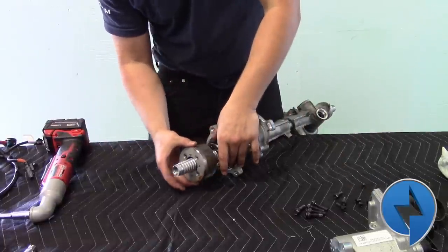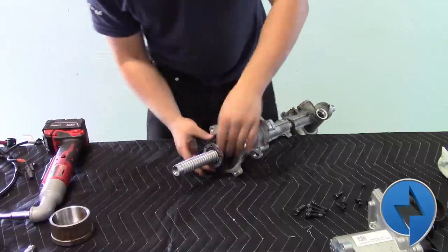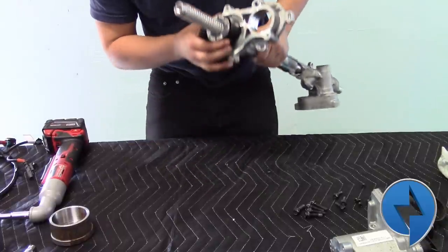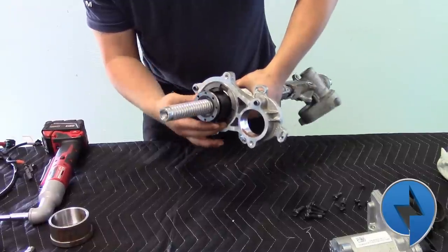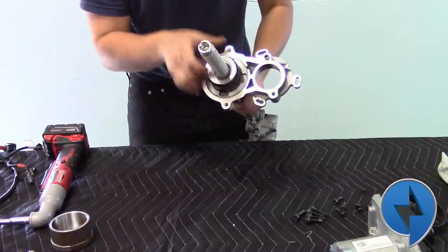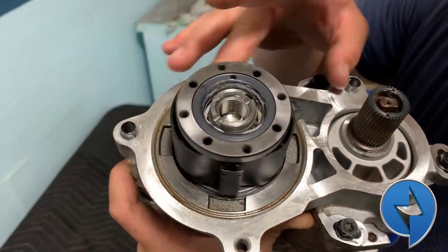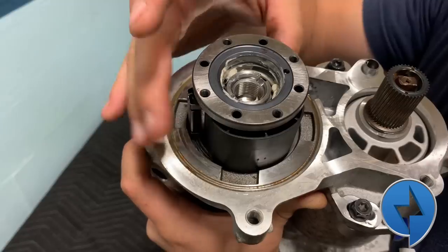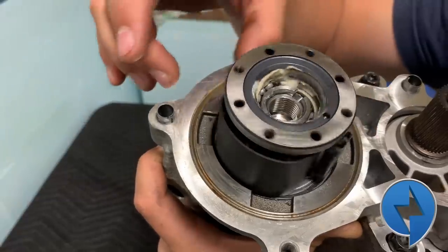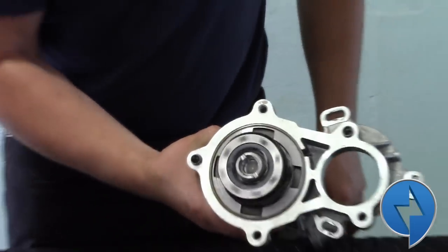This plate will come off with the larger belt. And then what we have here is the actual lead screw that actuates the shaft. I don't really want to go any further into this because the balls will fall out and make a mess. But I'll show you what it looks like at the top. You can kind of see that there's a spiral groove that matches the one machined into the rack. And then if you look closely you can see many little ball bearings that fit in the groove, which allows for very efficient, fast travel.